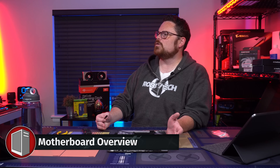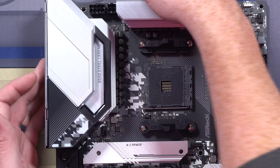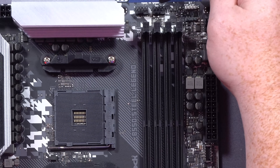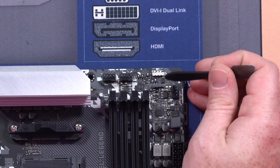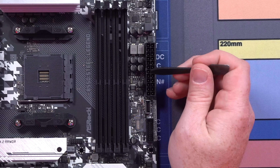What I try to do is educate you a little bit while we're doing the build. So the first thing I'm going to do is walk you through a motherboard. Up here in the top left are your EPS CPU power connectors — this powers everything right here. Over here we've got our fan headers, our CPU fan header, and then just a normal fan header. This is an RGB header right here in the center — we have a 4-pin and a 3-pin. The 3-pin is actually addressable.